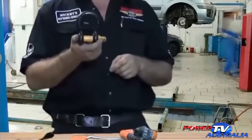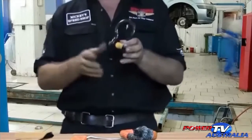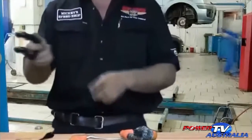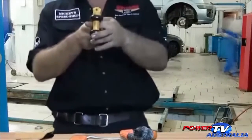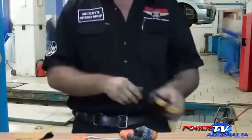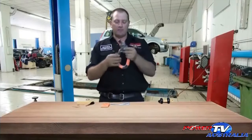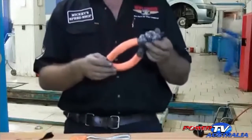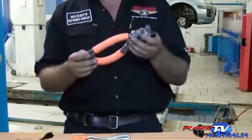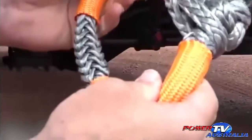Normally what you'd do in a recovery situation with your snap strap or your tree trunk protector, whatever it may be, is you would attach your snap strap to this, put that to the recovery device on your vehicle, and then move from there. What has recently come out to replace that in a much safer way is this one here. This is made of rope and is actually rated at 9 tonne. It's a lot lighter, won't rattle around your toolbox, and is much safer for your recovery devices.